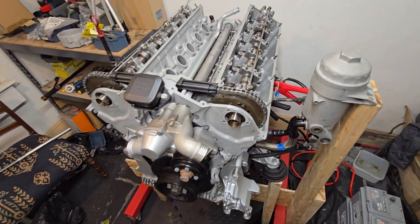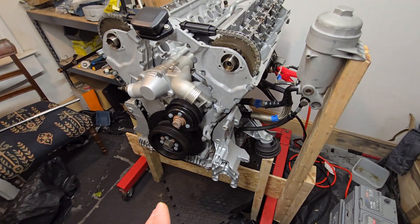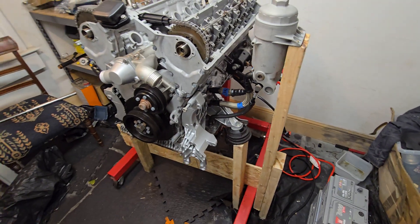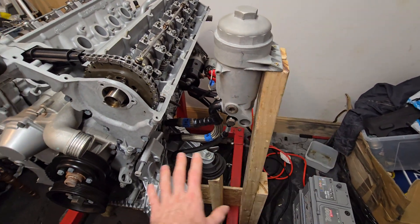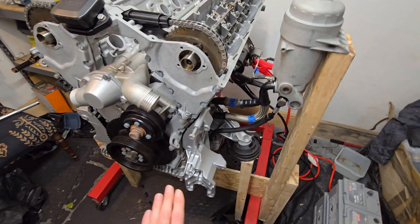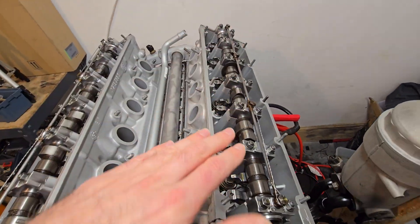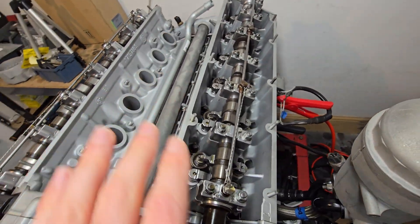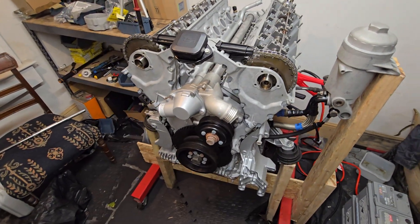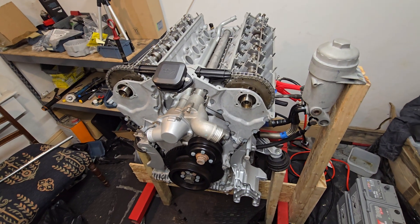The purpose of this video is to show you, with the valve covers removed, all the components spinning. The cool thing is the engine will actually generate oil pressure. We have our oil pump located in the sump down the bottom, we have eight litres of oil inside the engine, and that's kind of why it's on this strange looking jig — we have our oil reservoir here with our oil filter that's going to be supplying filtration to the oil passing through the engine. As soon as we power up, oil pressure will start to build, rise up through the block into each of the heads, and oil will slowly graduate towards the camshafts on both sides and our oil sprayer bars, beginning to provide lubrication to all our head components and camshafts. It's a really cool process and something you can typically do after an engine rebuild, essentially just to make sure the engine is generating correct and sufficient oil pressure.